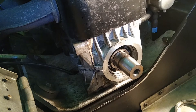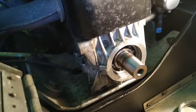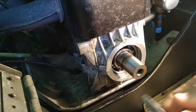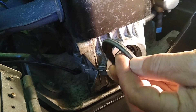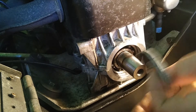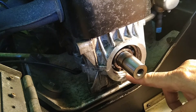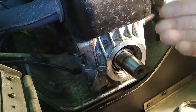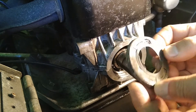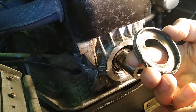Now this isn't the prescribed way of fixing a blown crankcase seal on the Fuji 488. It's not even the same seal we're going to put back in — it's a Skidoo model seal. The original seal has a ridge on it that fits into a corresponding groove in the engine. You can only do that by splitting the case, which is a lot of work.